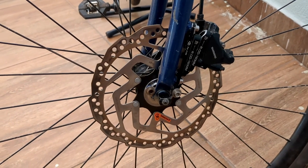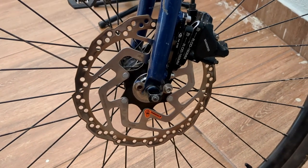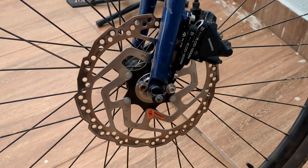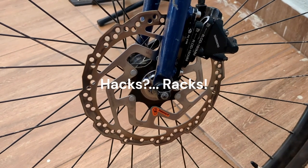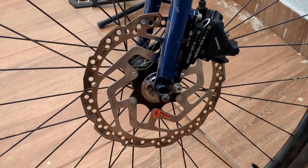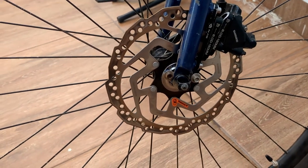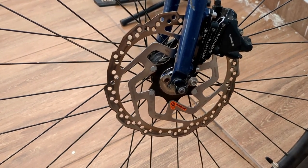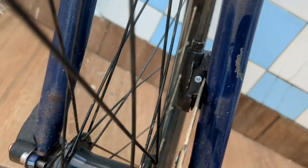That's it for this first part. For bike touring — and even for gravel — Big Tork says 180 millimeters is good even for road cycling if you're heavy. My setup: I weigh 70 kilos, the bike with rack weighs 15, and I was carrying 35 kilos on the back — that's about 120 kilos total on a 160 millimeter rotor. I was eating pads and then rotors, so the 180mm upgrade should help a lot.